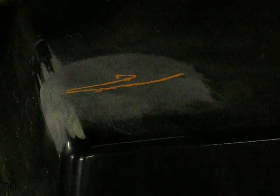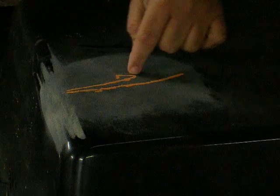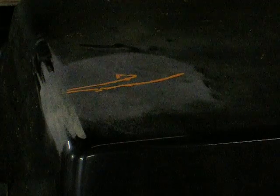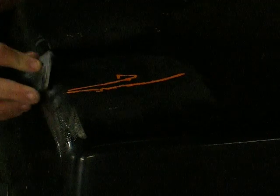This area is covered with tooling gel, and I took some 80 grit and went over it — this is the actual scratch I dug out. I'm going to start wet sanding now. I use this nice little squirt bottle because I've used sponges and rags and all kinds of stuff over the years and I end up with just too much water.